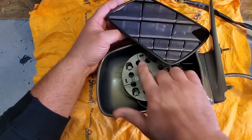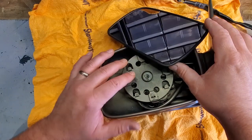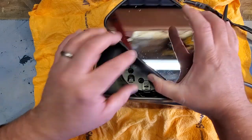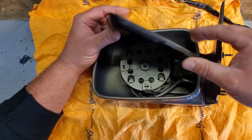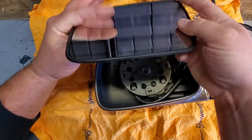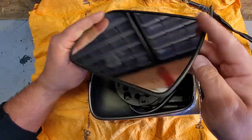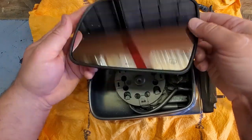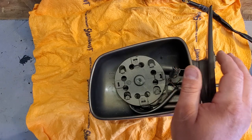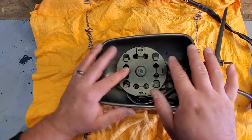Detached. Now, if you guys have seen my mirror restoration video, you will know that the glass does not slide out this easily with the factory glue. It's only coming out this easy because I made sure to not put double-sided adhesive on these little tabs. So if you're going to take your mirror out for the first time to fix your motors, you might want to have those backup mirrors ready to go so you can put in new glass if you break the glass. So I'll leave the link in the description below to new glass, so hopefully you guys won't break it. But again, it is difficult. It is not this easy the first time you do this.